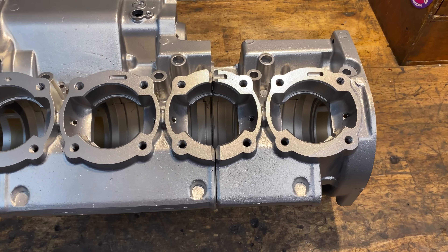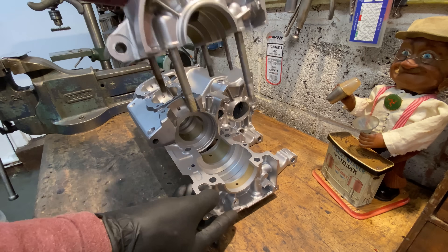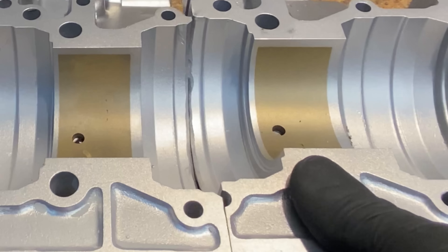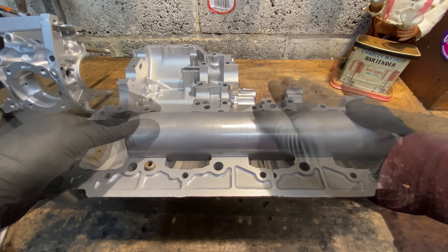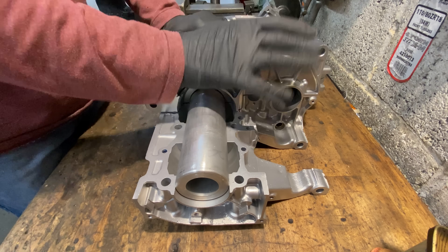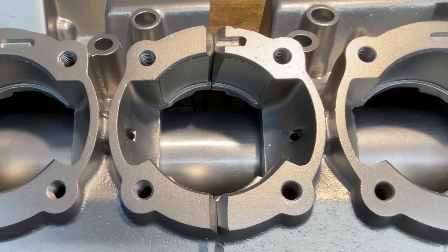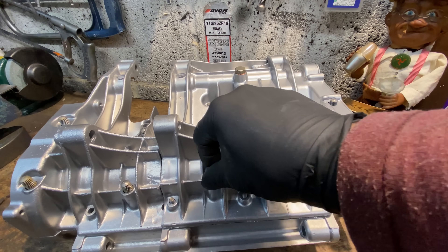The crankcases are now all ready for welding. But before I can weld them together I've first got to make up a mandrel that goes through the central main bearing journals. I've got one in stock that I use on my Z1 Super 6 — it's exactly the same diameter and fits into the crankcase just perfect. So I can align the two bottom crankcase parts, drop in the mandrel and it holds them in line longitudinally while I weld it together. I now place on the upper crankcase parts. You can see the mandrel in the centre holding it all in line, so the next thing I do is turn it upside down and lightly do up the crankcase nuts.